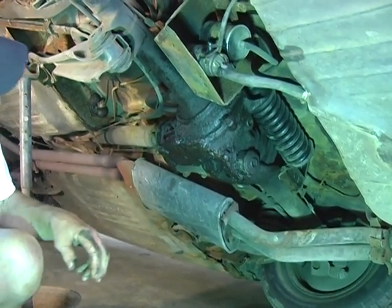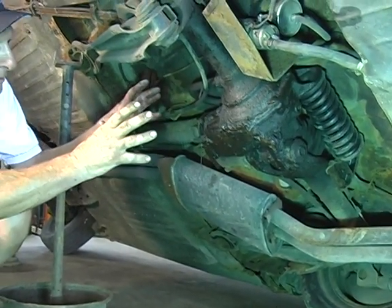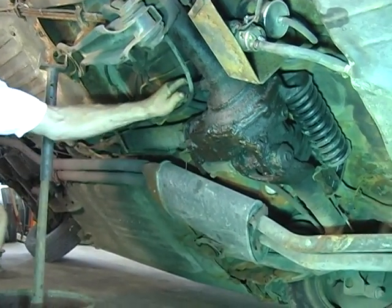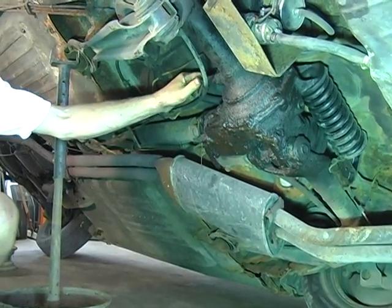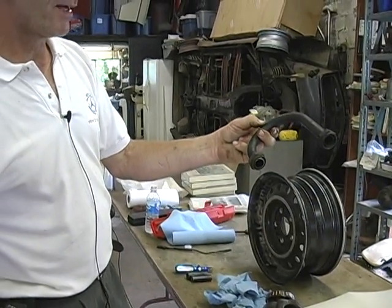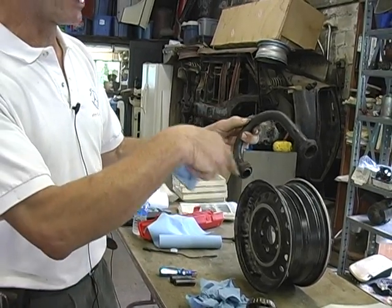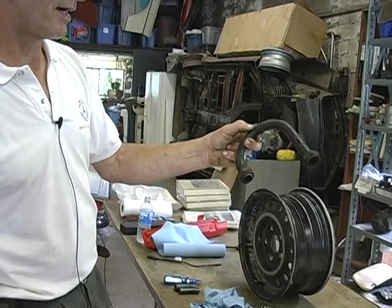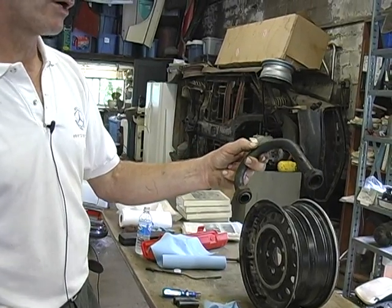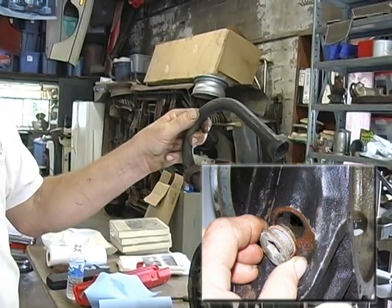The pumpkin on the V8 is a little bit bigger — the yoke assembly and everything inside is a little bigger, and it's got this cooling tube. The cooling tube will have to be removed when you install the axle in the 113 car. The V8 rear end has a bigger pumpkin and a bigger gear set, and it circulates a little bit of fluid through there for the extra torque and power coming off that V8. On your 113 car you won't need this — we'll remove it and put a fitting in to block off where the tube was.